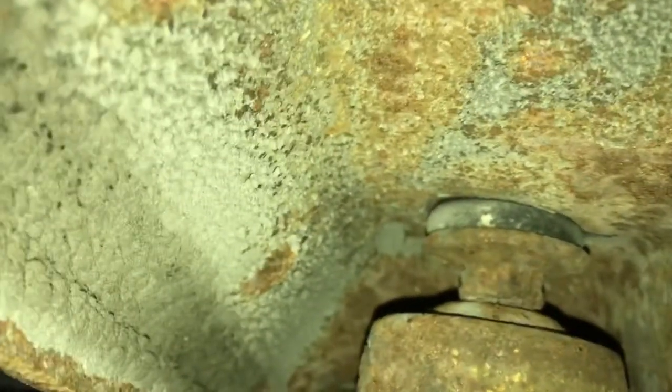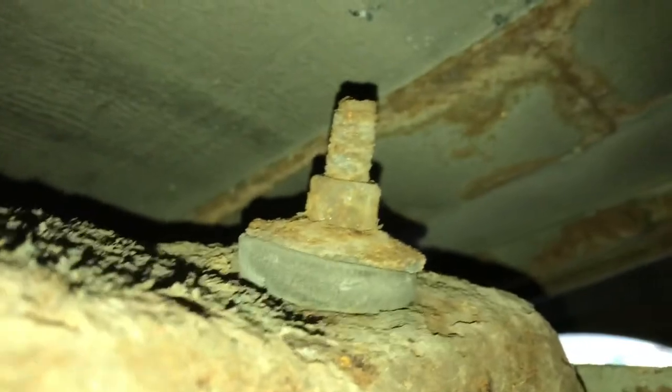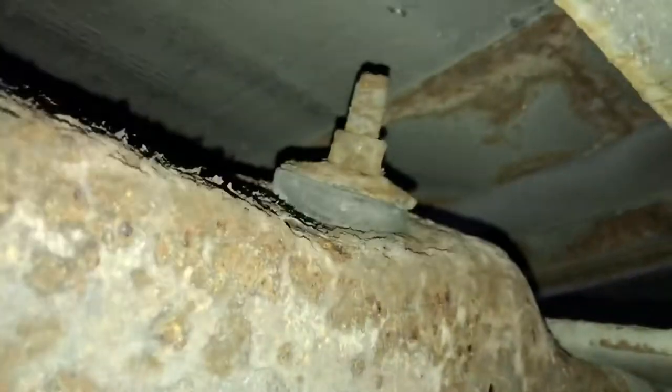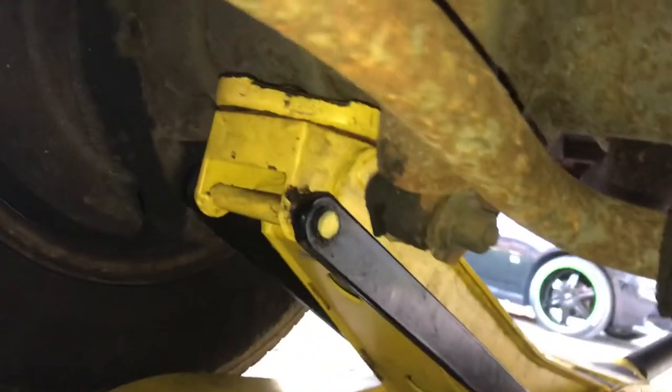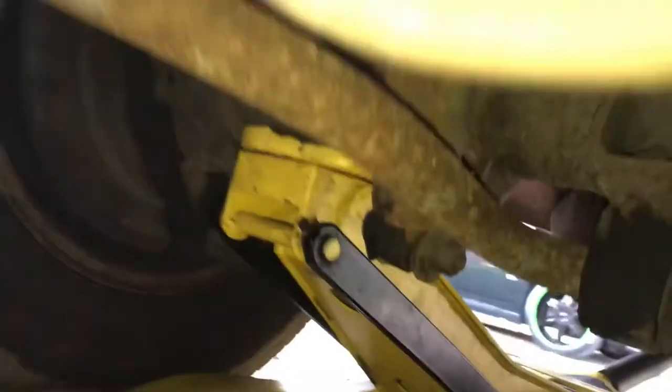Okay, so we're actually in the back now. As you guys can see, the back one has a screw that goes from side to side, and if we follow it up and look on the inside, it has a nut that we can hold and turn, and on the top it also has a nut — pretty much the same setup as the ones in the front. You can see that it really needed shocks bad. This is the easy one — we've got plenty of space. But of course there's always something difficult: the one on the passenger side, if we look down it's pretty much an easy bolt right there, but if we follow it up there's no space.